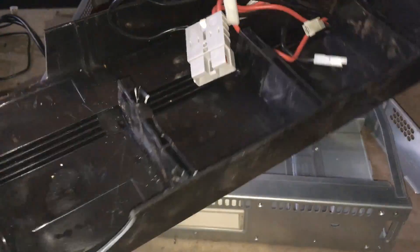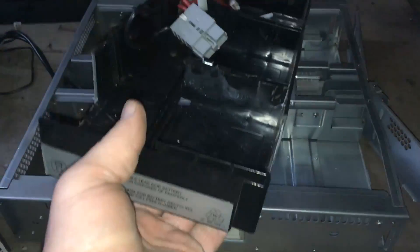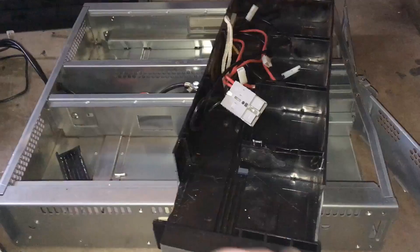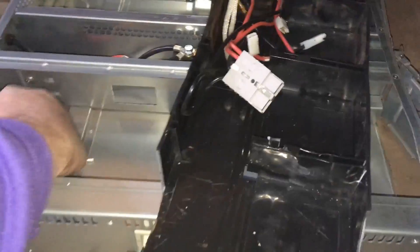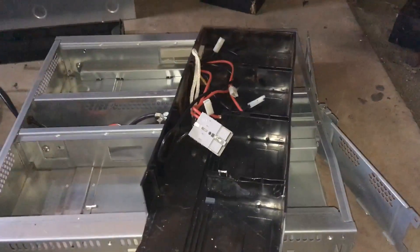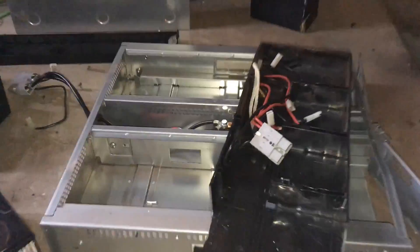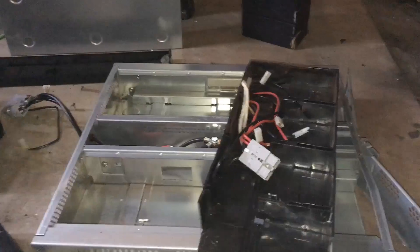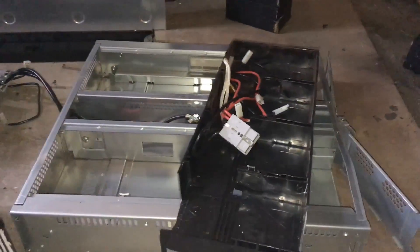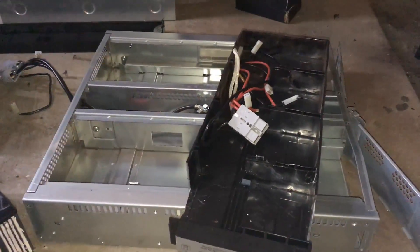Being an extended runtime UPS, its charging rate is probably a good deal higher, so it might inject enough current into these batteries to cause them to get hot enough to actually melt into the plastic tray. I would imagine there are friendly sellers on eBay that manufacture these from turned-in cores, and I can probably get one there without paying APC's price — because I don't do that unless the client absolutely wants it, and in this case the client is me.